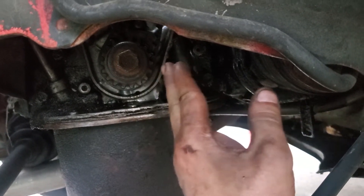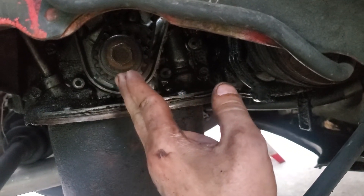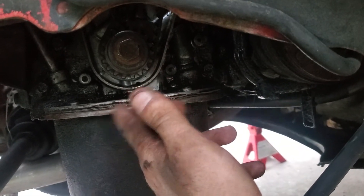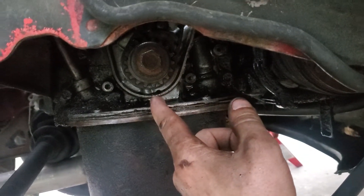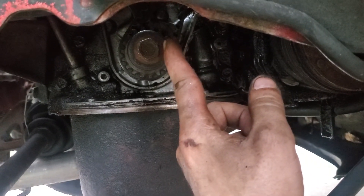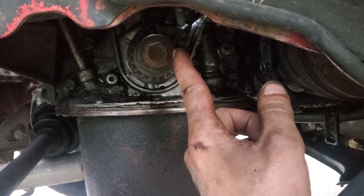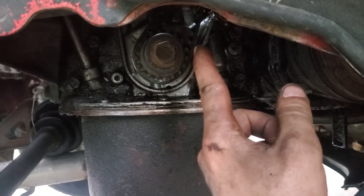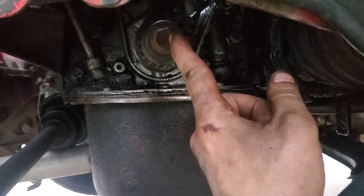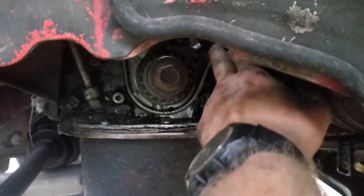There is no tension on this side, only on the left side. So you gotta get out the tension by advancing the crank sprocket. And then once it's lined up with the dot for the timing on the crank sprocket and the marking on the front cover, then you can try to slip it over and make sure you have a lot of tension on this right here.